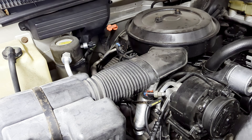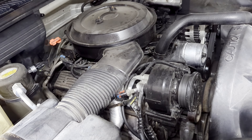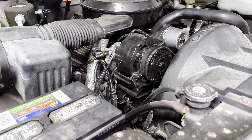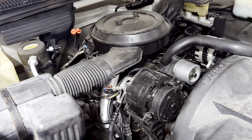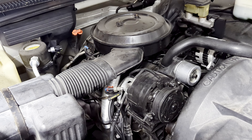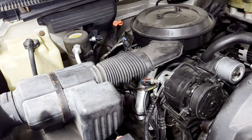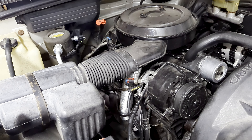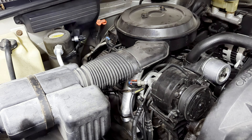Is there anything I can change without opening the system? The two things I know about are these pressure switches — all they do is tell the system when pressures aren't where they should be and kick off the compressor. Sometimes when I first start the truck and give it gas, the compressor will start to kind of kick on and off, which gives me an inkling that one of these switches might be causing that. I don't think it's going to fix my AC, but for a low risk, high reward situation you pay a little bit of money, switch these out, and see if that fixes it.